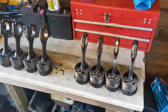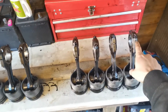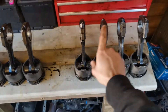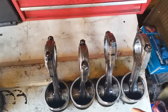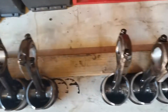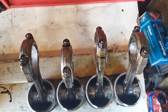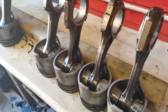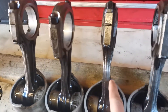Piston three is kinked the other way and piston four looks quite true as well. If I zoom right out you'll see from a bird's-eye view that piston one and piston four are in a very similar orientation to the other four pistons, so I believe they are relatively straight and true. Compare the overhead view of the good pistons — all perfectly aligned — versus the overhead view of the broken engine's pistons.